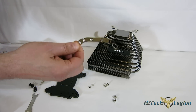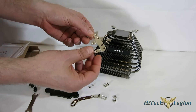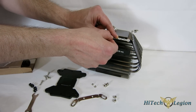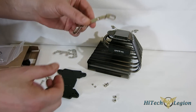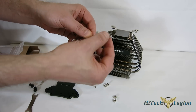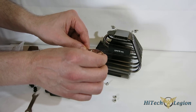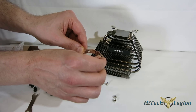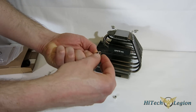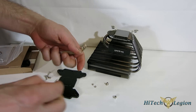I'm going to start with the step that the manual tends not to be clear on. If you're doing an Intel install on the 1150 series, 1366, or 775, that's where people are running into the problems. If you're doing an AMD install, you'll simply put your retention brackets on there with two small screws on each side. But in the case of Intel, there is a step that needs to be done first. You'll notice that it is stepped out, and from the side closer to you, you need to take the little two-part nuts — they're three-pronged for 775, 1150, and 1366. Choose the appropriate slot and put the small threaded side through there, then around the other side take the cap and tighten it up, and put that in place.